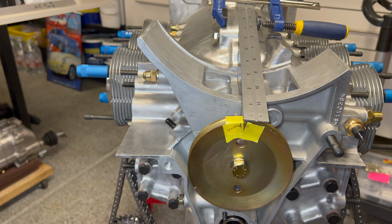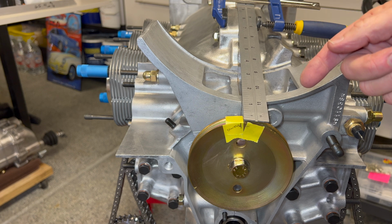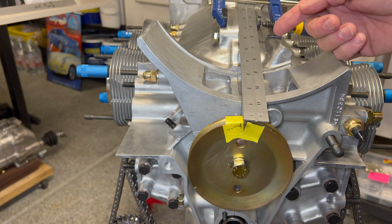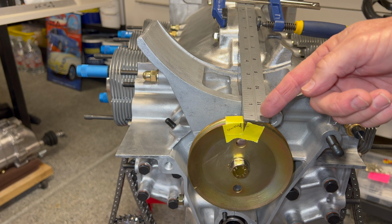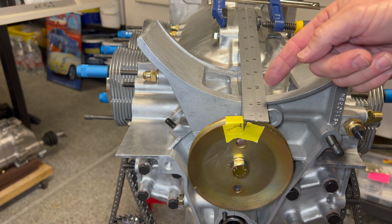And also, to perform our valve to piston clearance check, it's going to be necessary to sort out our Z1 mark and find our timing and make sure we're at absolute top dead center. In this case, it really is remarkable. Our Z1 mark is so spot on. It's hard to believe that they can stamp that and get it that close.